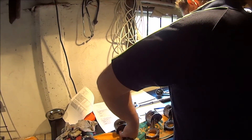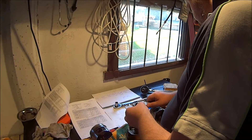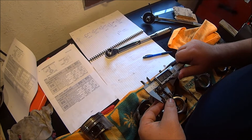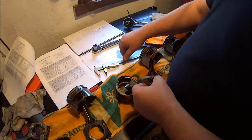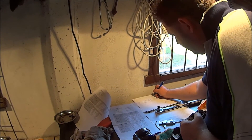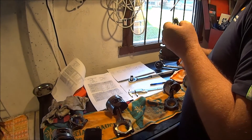On number 3 I should also measure the thrust face because this is the one with the thrust bearing on it. It says 21.8 — 21.78, 21.78, 21.79. So I'll note that one as 21.78/21.79 average, thrust face. I'll check that against what it's supposed to be — I don't know what that should be.